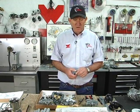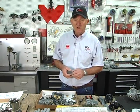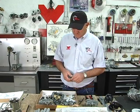The standard rule of thumb: run the smallest amount of fuel that will make your car run well. Play around, downsize the main jets until you get too lean, then step back up into it. It's a minor investment in calibrated parts and a minor investment in your time to do all this, but if you can find 7, 8, 9 miles to the gallon, it doesn't take long to pay for $30, $40 worth of jets.